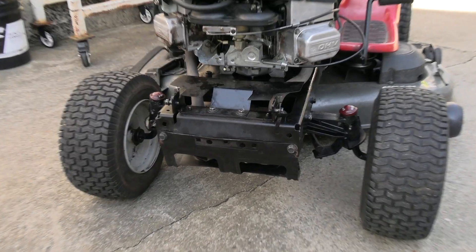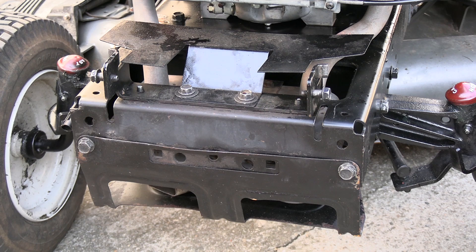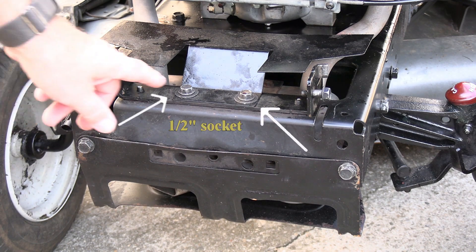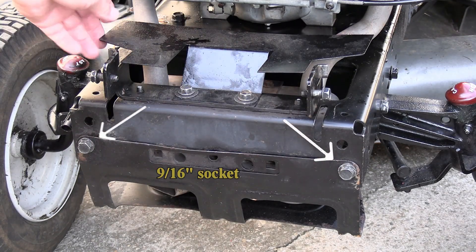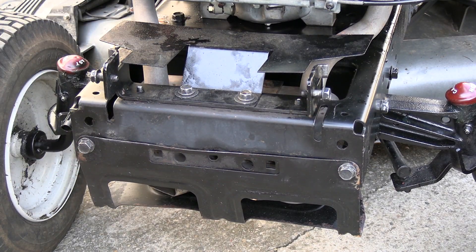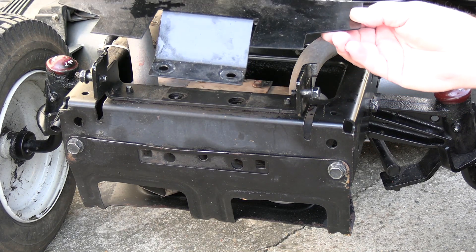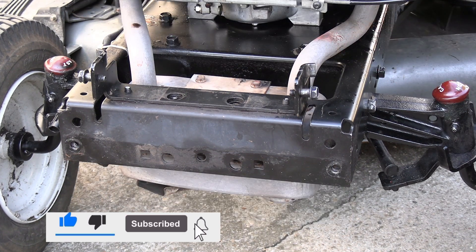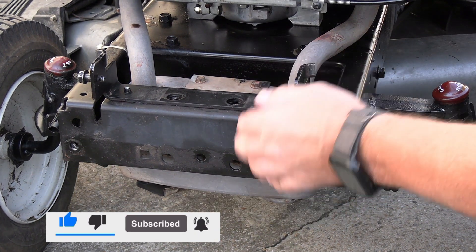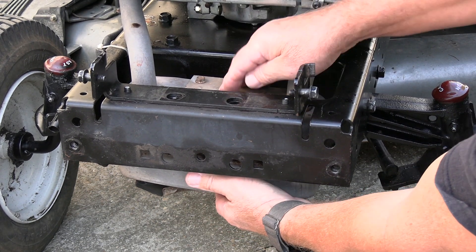What I want to do right now is remove the muffler. I'm going to take these two bolts out, and these two bolts here out. This plate will come off and this plate will come off. Just lift this off, put it out of the way. Now at this point, since the bottom plate's gone and top plate's gone, you can just go ahead and remove your exhaust.